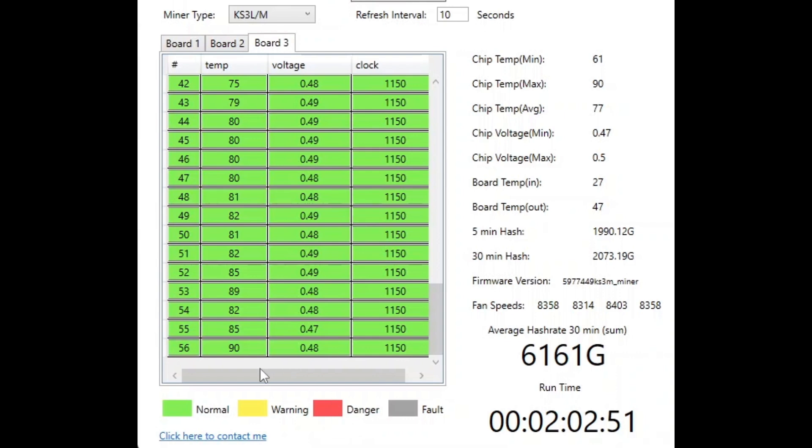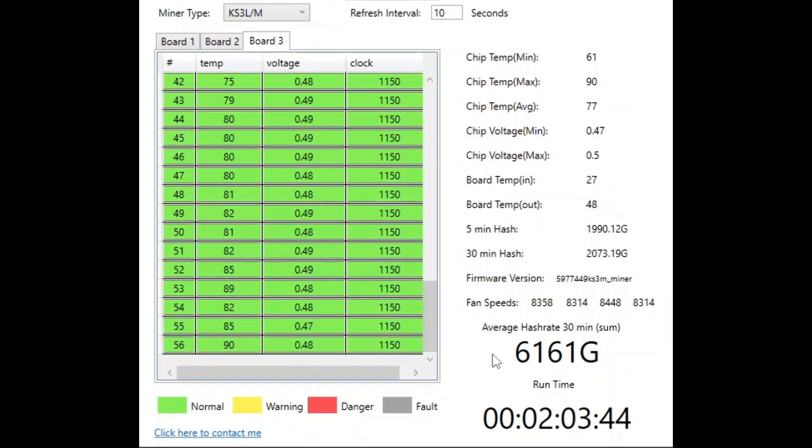Those 95°C temperatures are probably where you get into the danger zone. On Board 3 earlier my temperature was 91°C, showing up in yellow as a warning. It's back down to 90 now as it cools toward night. I definitely need to repaste — with a Fruition Designs kit nearly maxed out on this KS3M and cold garage temps, I should be seeing cooler chip temps than this. RPM used this tool to diagnose his KS3M, changed the thermal paste, and dropped chip temperatures significantly — his hash rate went way up just from changing the paste alone.